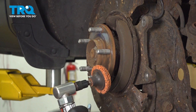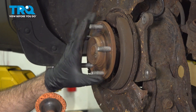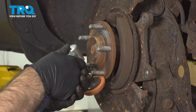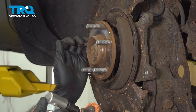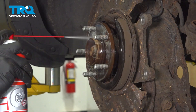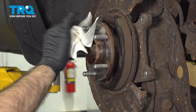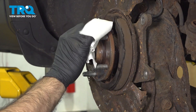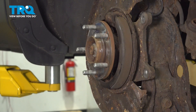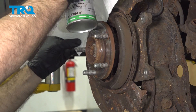We're going to come back in with our angle tool here with a mild abrasive on it. Don't use any heavy sandpaper — we're not trying to take away metal, just clean the surface. Now that we've cleaned up our hub, we're just going to finish it with some brake clean and a quick wipe. Once that dries off, we'll put a nice little coat of anti-seize on that surface. The anti-seize we're using is in an aerosol can, so I'm going to block off the potential of spraying onto our pads here.